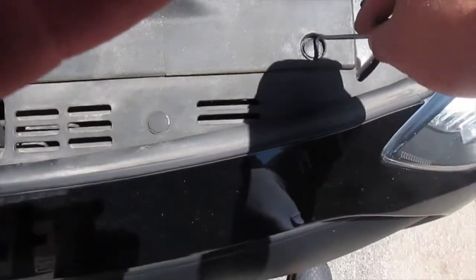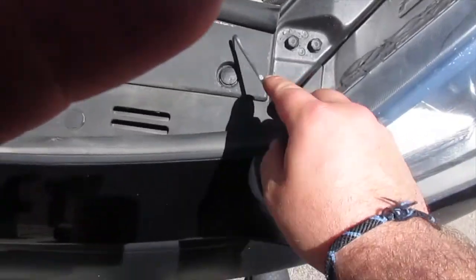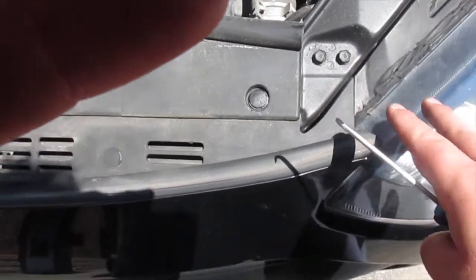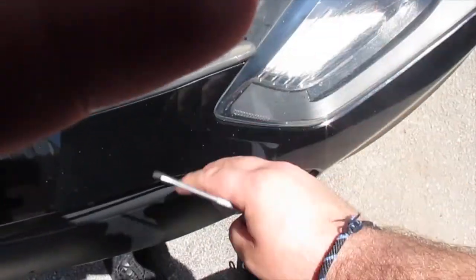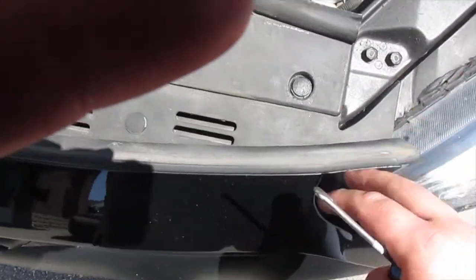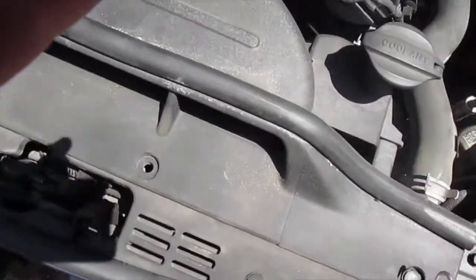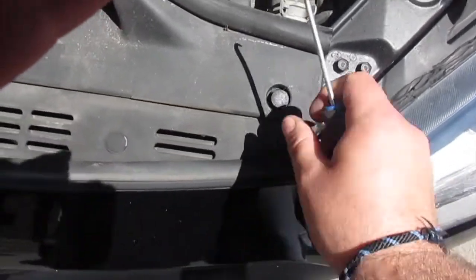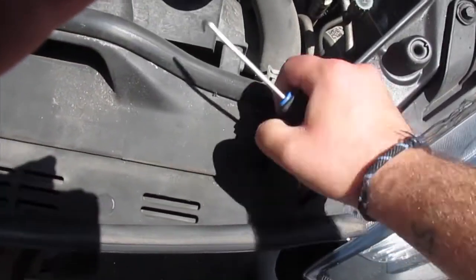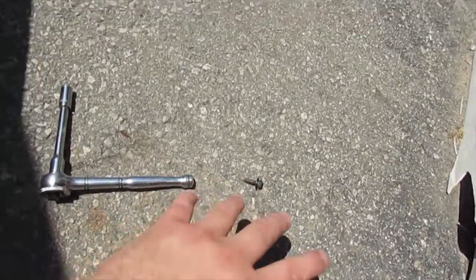Whether you have a new set of headlights or you're taking your old ones out, you're going to have to take out these tabs here and take the bumper off. I'm taking the bumper off — I know you don't have to, but I'm not about breaking the front bumper or damaging this little lip here. I just take it off properly and be safe. So I'm going to take off these clips — there's four of them. If you have a pick, they come out so easy, like that, down and up. And it comes out nice, and then you take this whole thing off. After you take them out, keep them close by — put them somewhere so you don't lose them.